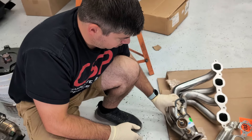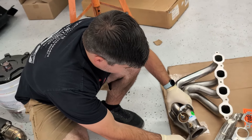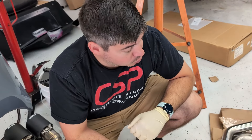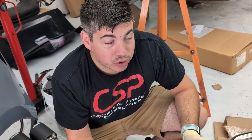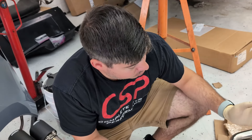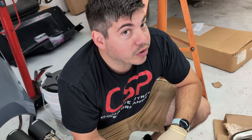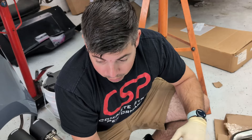We're going to put these on now, see if there's any check engine lights, and basically let her rip. Get her on the dyno. Find out if there's any horsepower gain on both pump gas and E85. We're only measuring this in rear wheel horsepower, so we're comparing the 440 baseline to whatever these do as the new baseline. Maybe 455? That would be pretty cool. This is going to be the combination of header with cats.